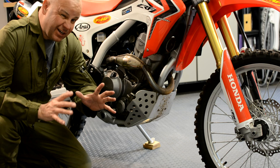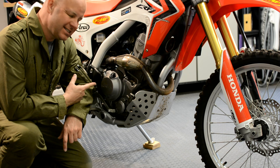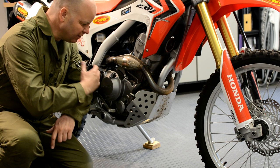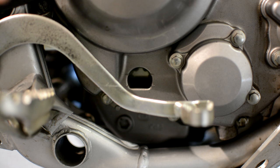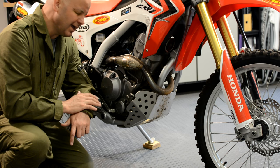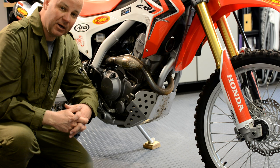Just before we get started, a couple of things worth mentioning. Normally I would warm the bike up to make the oil nice and warm and runny so it runs out easily. In this case the bike hasn't been anywhere since the MOT three weeks ago — it's just been sat in the garage, so the oil will have nicely run out of the cylinder and be sitting in the bottom anyway. The other thing worth checking before you drain the oil is the sight glass on the side of the engine to see how much oil is in the bike. This one is about half full with the bike upright. When I come to fill it up again, I'll make sure the sight glass goes to a similar level — it's important not only to have enough oil but not too much, as overfilling is just as damaging to the engine.